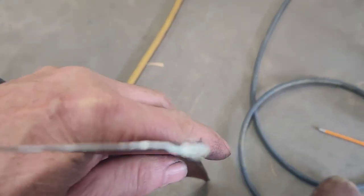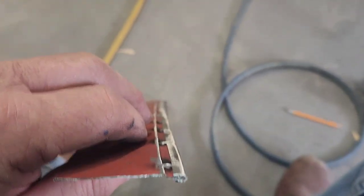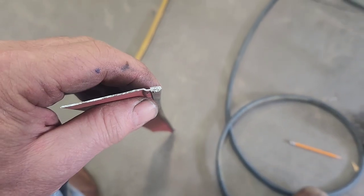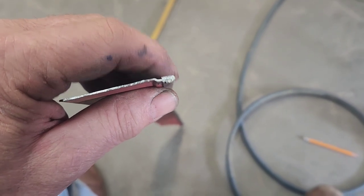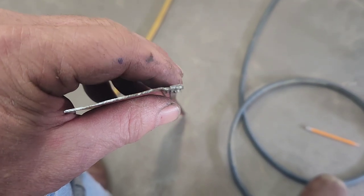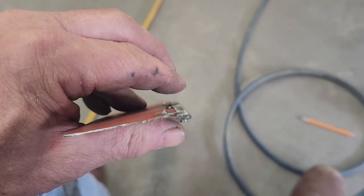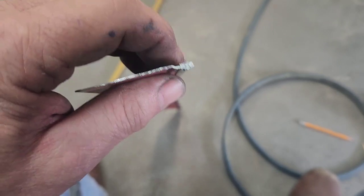You can see where I stepped this down - this is the top surface, and now it has a nice bull-nose on it which gives a nice clean finished edge. It's also triple-thick now, so that gives a little more rigidity out on the edge. Because it's stepped, when it comes time to epoxy it in or Bondo over it, it's flush with the top surface - it doesn't have a little lip going up in the air as it would if you banded it in the opposite direction.